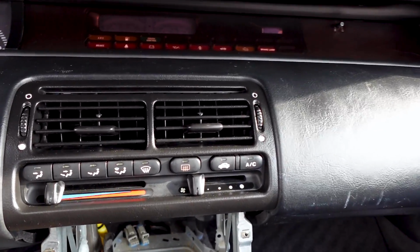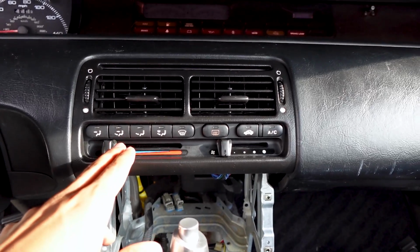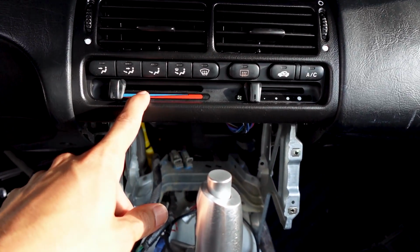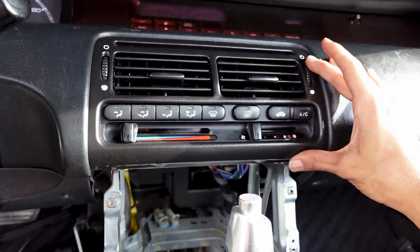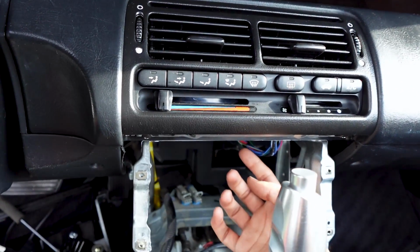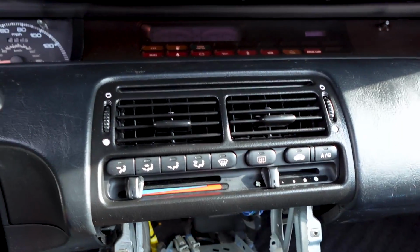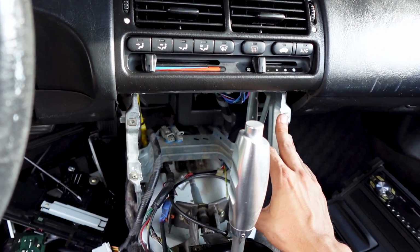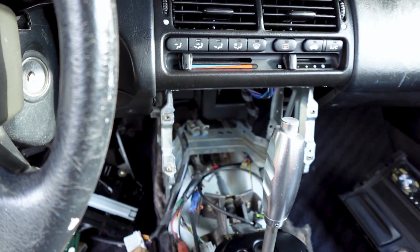That's going to be it for this video, guys, on fixing the climate control. Of course, we had the 95, 96 update on the panel and the climate control face itself. And then I showed you guys how to fix the actual AC and lights from coming on and off at the plug, resoldering those pins, and of course just taking everything in and out. But the next video, I'm going to be taking care of the panel down here for the radio, the ashtray, and the cigarette lighter. So make sure to catch me on that next video.